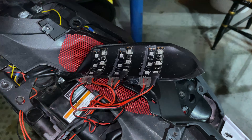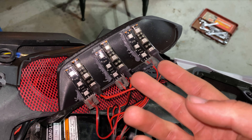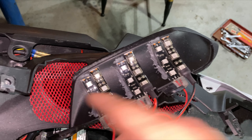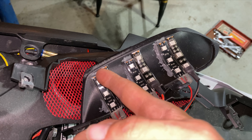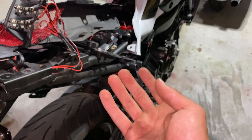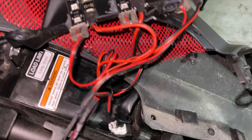Hazards — pretty cool. You can buy these on Amazon. You see where the orange is, the little orange pieces. Once you snip those and cut those, you don't have to solder them or anything. All you do is use silicone and you kind of seal them off for the elements, because especially if you're going to be washing your bike you're going to get water underneath there. If it's raining, water is going to splash up underneath. So you just want to make it weatherproof and make sure everything's good.